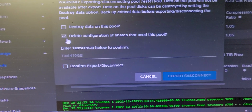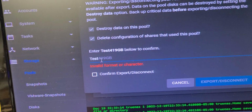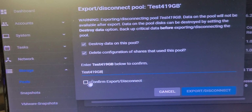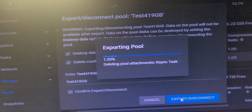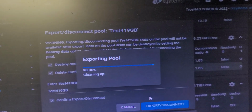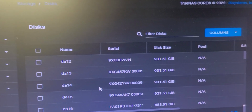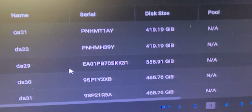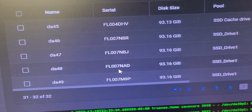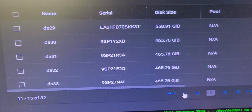But as you can see here, I'm just getting myself ready to decommission disks and bring in new disks and bring them into the equation. So I'm going to confirm this, and now all my 400s, or equivalents, have been phased out. I think I do have a couple of 600 gig drives I did not allocate into pools, but I want to go over here to disks and just confirm. Yep, see them? Got a few 500s. They're odds and ends. And unfortunately, if your make and models are not the same and they're not exact, then you're going to have problems with this setup.